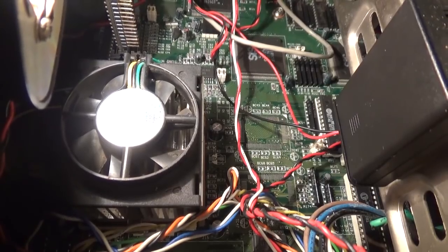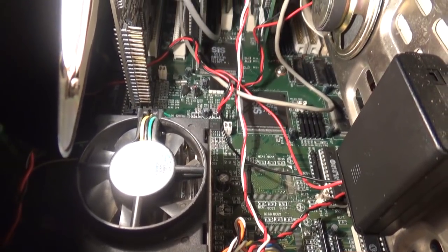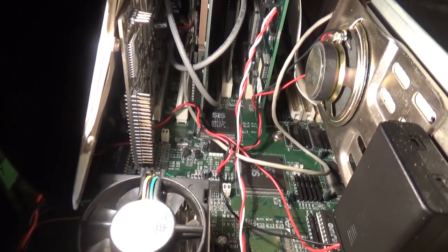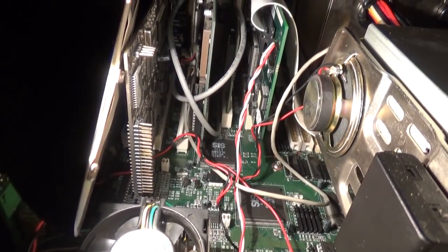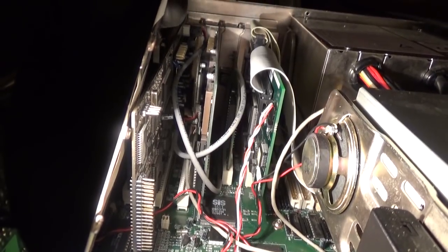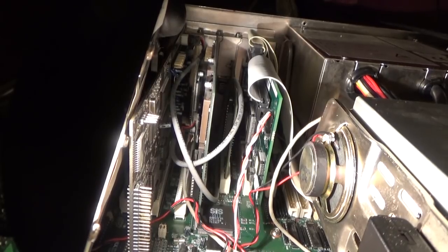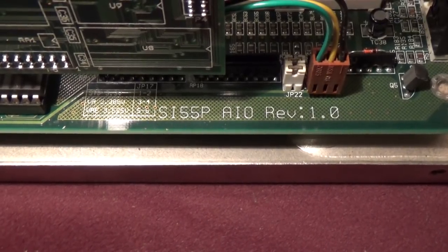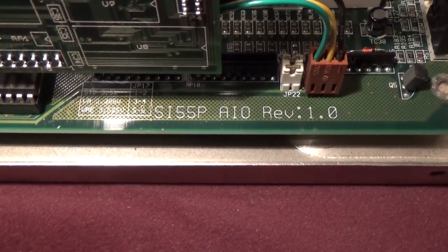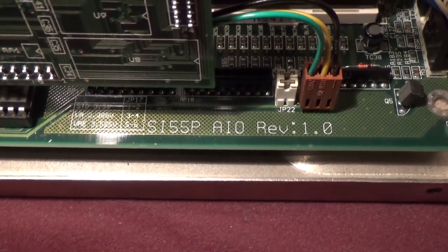Before we finish with the board, it's probably worth noting that the CPU front side bus is only rated for between 50MHz and 66MHz on this board, so you won't be plugging one of those Cyrix chips that have the 75 or 83MHz bus speed into it. You could probably use a 50, 60, 66MHz one, I believe it does support those. You might actually be able to get higher or lower clocks through undocumented jumper settings, but don't expect it to work well, and I'm doubtful the SiS 5510 was really rated to go any faster.